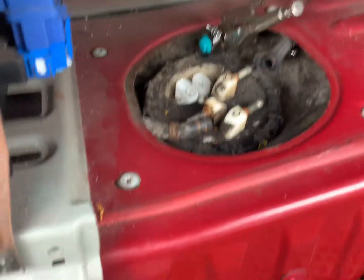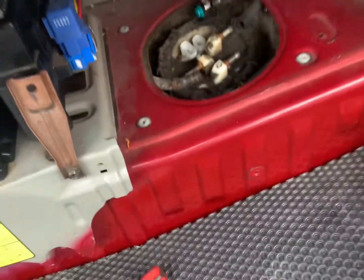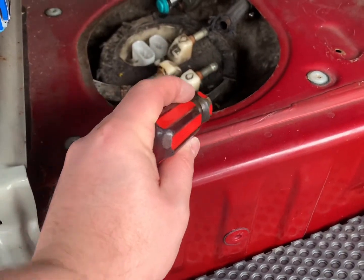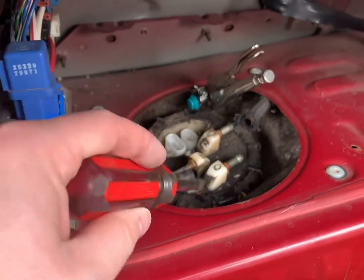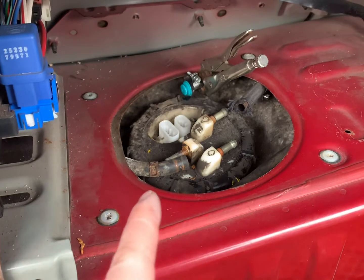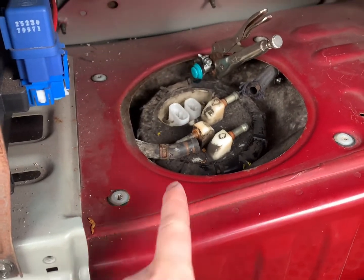All the lines are off. Now for taking that ring off — from what I've seen you're going to want a flathead screwdriver and a hammer. Line the flathead against the notches and gently knock it — you'll probably need a bit of force to get it going but then it should start to undo. Once you've undone that ring you'll be able to take the pump cap off. It's an absolute pain on your back and legs bending into the boot, but needs must if you want your fuel gauge to work.